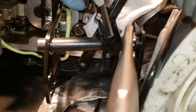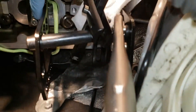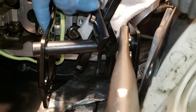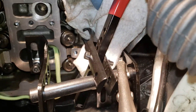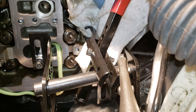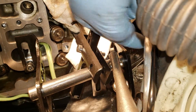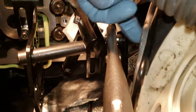That's just grease I used to keep the keepers in place. I cut this rod horizontally and reused some of the stock bolts to bolt this frame down, and it worked perfectly fine to get at all of the remaining exhaust valves. I'm using a pair of vice grips to keep the rod from falling through because I cut it a little bit too short — if I kept it longer I probably could have just let it rest against the chassis.